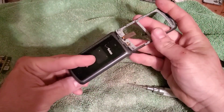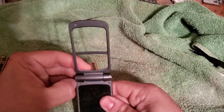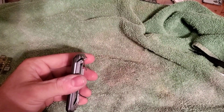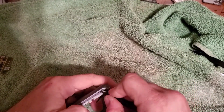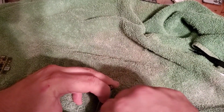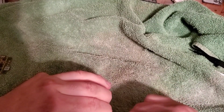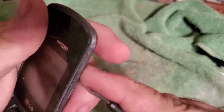I'm not too sure how to get the screen apart — oh, look at the water in there. I've never taken this one apart, so I'm assuming there's just two screws and it's clipped on. I'm usually won't do this, but I'm not going to worry about scratching up the housing, so I'm going to use my metal screwdriver. I never do this on a phone because you will indent the plastic and it'll look terrible — I've done it a couple times and hated myself for it. So if it's a phone you're keeping, don't use a screwdriver.